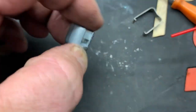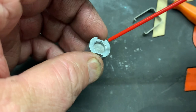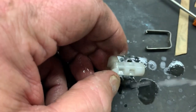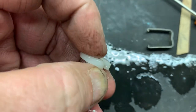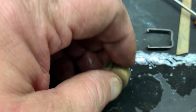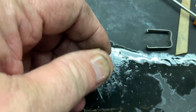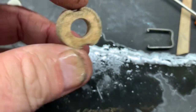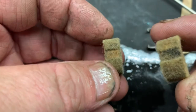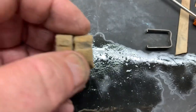The way that you would clean this screen really well is to use some brake cleaner or carb spray and back-flush the screen. In my experience, you can only clean them a couple of times until they just get so saturated with dirt and debris that they won't filtrate anymore. So you want to clean the cotton gauze main filter and blow them out with compressed air, and then we can reassemble these filters.